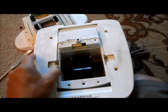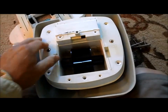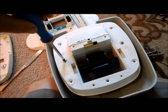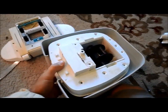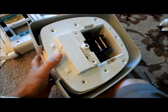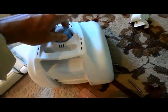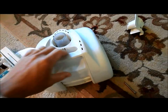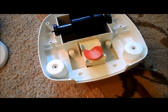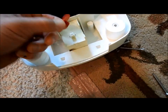There are four more screws on the body to take off. Pull this off and there are two more screws. Here's the important part: when you get these two out, you have to turn the unit the other direction. If you don't turn it over before removing this panel, the gearbox will fall out — that's the box that controls the upper movement — and it's complicated to rebuild.